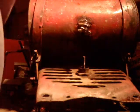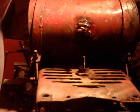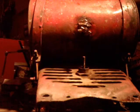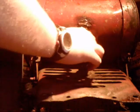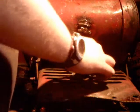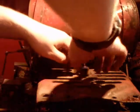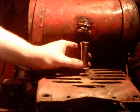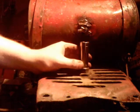And you want to take the bearings. Make sure they haven't gotten dirty while they're on your workbench. They are sealed bearings, but still, the cleaner they start out, the better off you'll be. Just take it, slide it down over. Actually, that one just pressed in with my fingers, so that's no good. But just take and give that a light tap or two with the hammer.